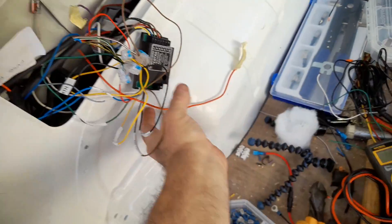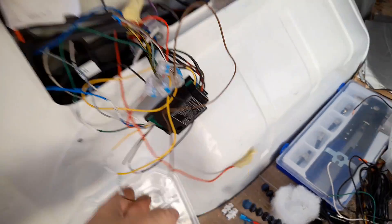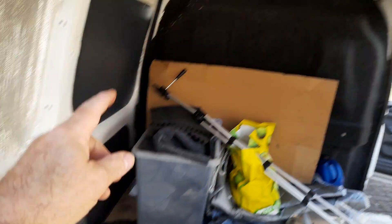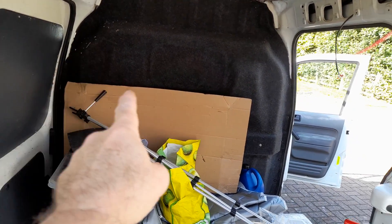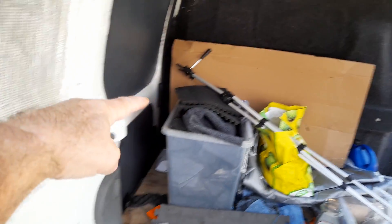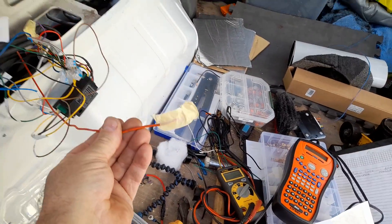Thank you for watching guys - I hope this has been some help to somebody. So if you're putting in your tow bar electrics, you've wired in your box and nothing's happening, that's because you haven't got a 12-volt feed going into there. I would make it switchable, which is what I'm doing personally. Actually, I could come out of that fuse in the passenger seat, run it to one of the new switches by my right knee, and then run the cable back and connect into the one that comes here - so it'll be switched by the switch by my knee. But you've got to make sure the cable is the right grade to carry the amperage that the fuse is rated for - 15 amp in this case.